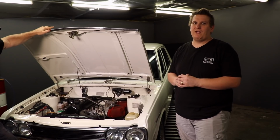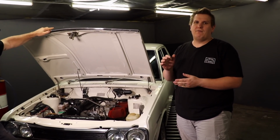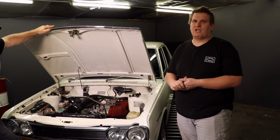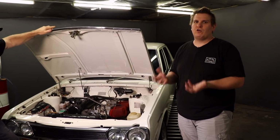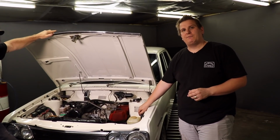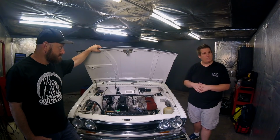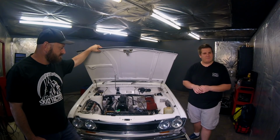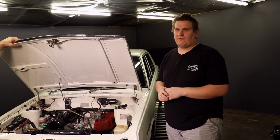We can map ignition conditions based on RPM or throttle position or manifold pressure. That gives us way more scope to control ignition over what the humble 80s ignition is capable of doing. Our first step is going to be to substitute the distributor, and we're putting individual coils on the car, and we'll just see how it behaves after that, and we'll take note, and we're curious as to that outcome on the dyno, and from there we're going to then substitute in the EFI.